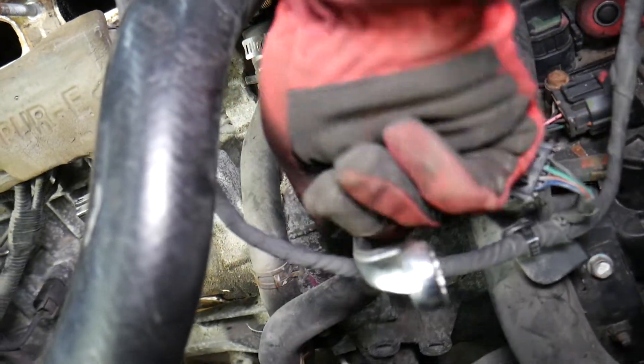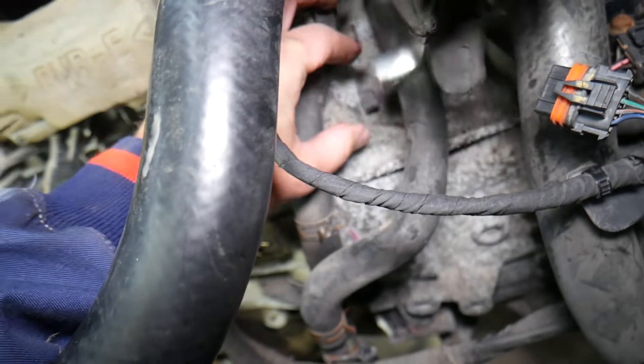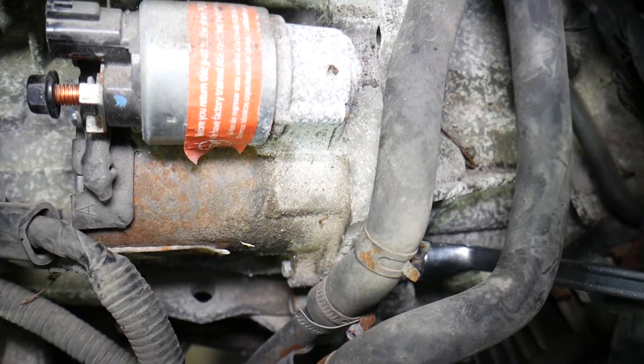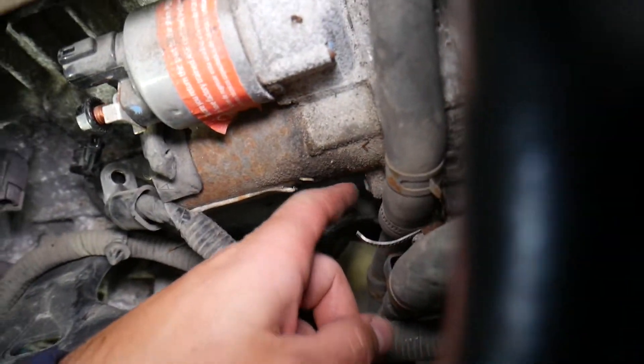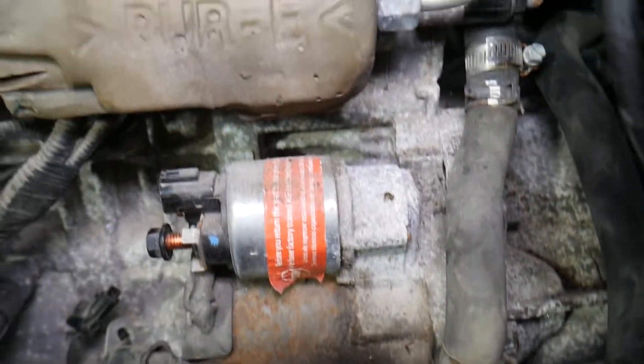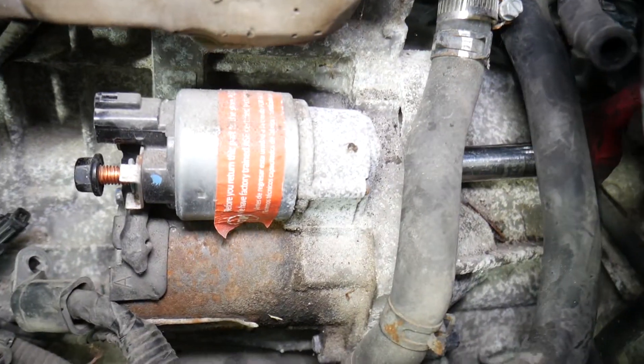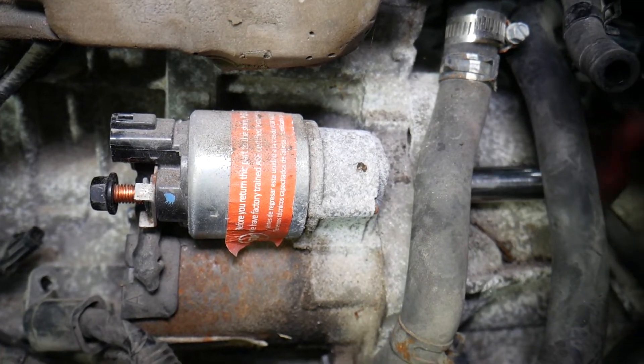Next, use a 14mm socket. From the transmission side we have two bolts to loosen — once we get them loose a little bit they'll go by hand pretty easily. You can spray a little bit of penetrating spray on the bolts. One bolt is right here and the other is on the back side. Also, if you remove your intake manifold and your valves look dirty like ours, you need to inspect or replace your PCV valve as soon as possible — you're probably pumping quite a bit of oil into your engine and may notice increased oil consumption.